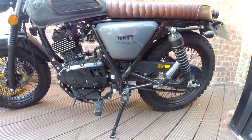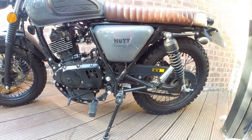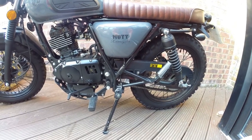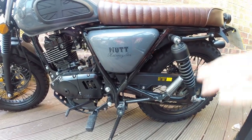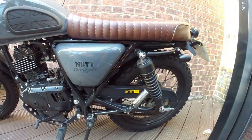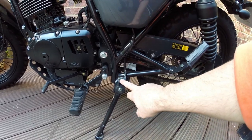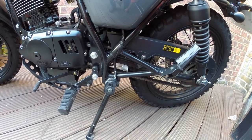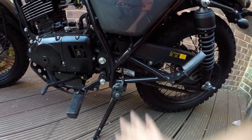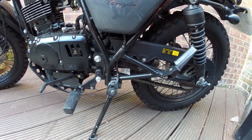There are a number of issues that arise from Mutt ownership that we haven't dealt with, mostly because this is not our primary bike and we don't ride it daily. One of the headaches is the electrics that deal with the indicators — this is one of the later LED ones, but the early Mongrels always had electrical issues with the indicators. One of the chief issues is the side stand kill switch, which is very vulnerable. With the movement of a side stand, whenever you wrench wires and fixtures and fittings you're going to have a connectivity issue — especially on the rocky stuff that Radar brings me on.